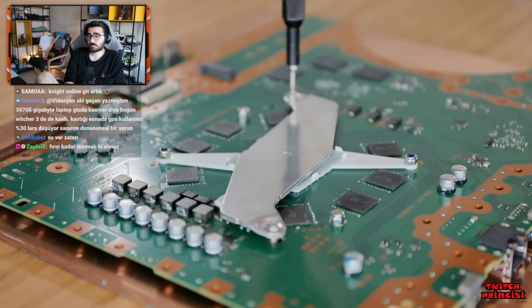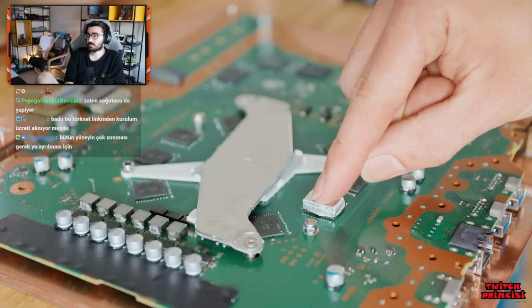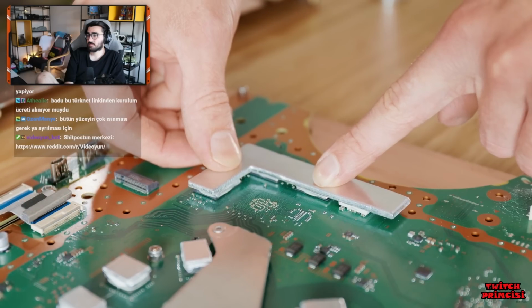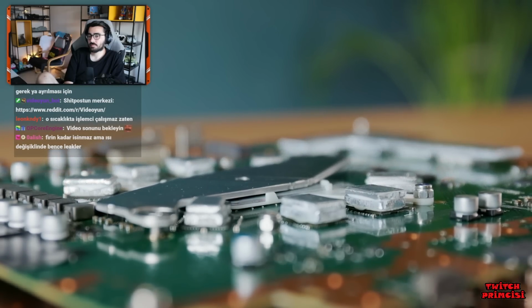brackets to put downward pressure on the back of the processor. And in addition to that, there are some components on this side of the board that also need some thermal bridging, though this time to a lid that I've not made yet. These aren't particularly power-hungry components, so having the heat dissipated to a lid should be quite adequate for them.